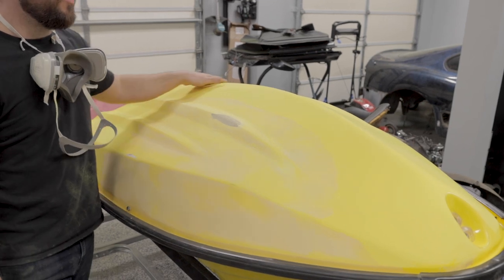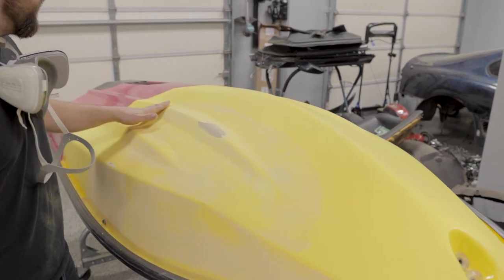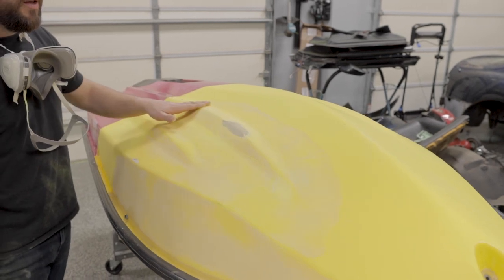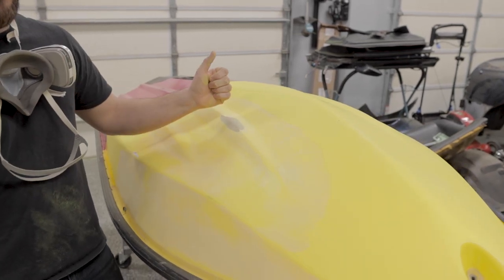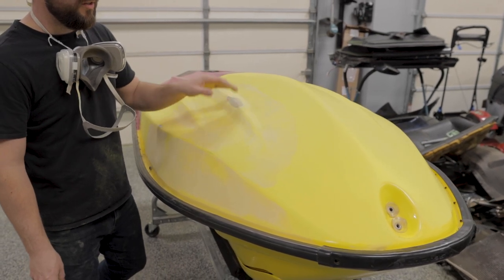Now I'm going to take a look at the top of the hull. Now that our entire hull is sanded down and I've gone through the chines by hand and matched the OEM towards the back, I'm going to wash it down with just water and dish soap to lift any oils put in by my fingers or anything else.